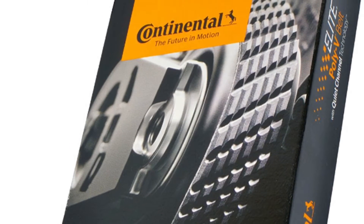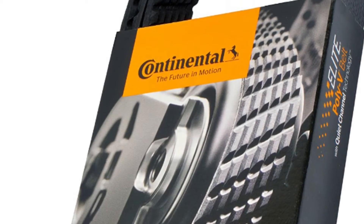I wanted to add to the video — I forgot to mention how you replace the serpentine belt. The belt has to be touching each of the wheels in there; if it doesn't, you're going to have a problem. The belt I bought was not a standard belt. Normal belts just have lines going across, but the new ones have grooves to help with noise so you don't hear a lot of crazy sounds when you put the belt back on.